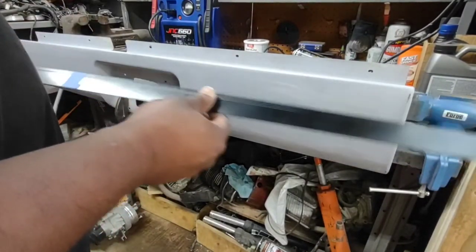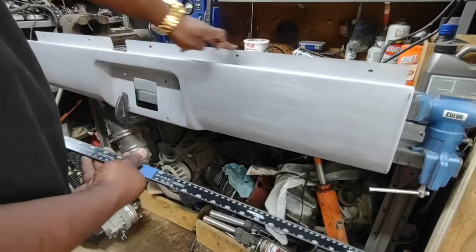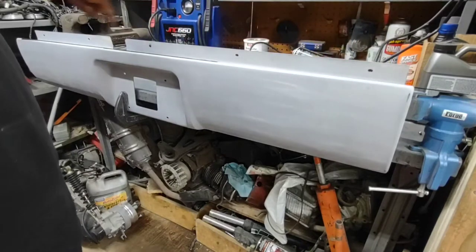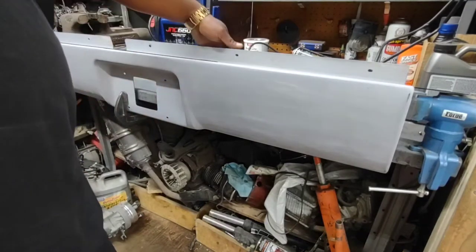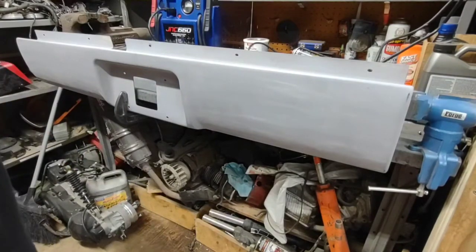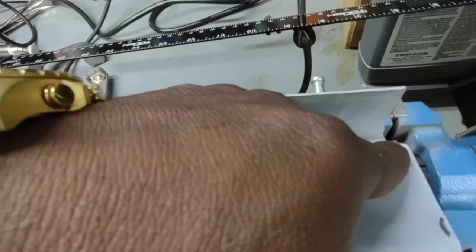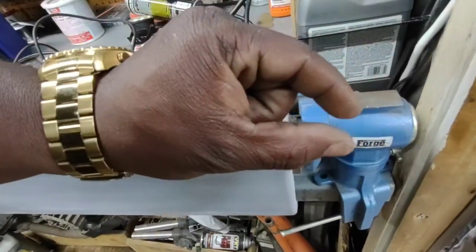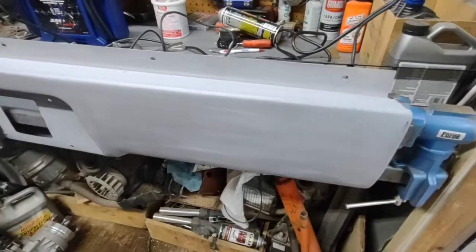So I had to go to Walmart and get me another ruler — one wasn't long enough, so I taped the two together. What I'm going to do now is go ahead and just cut the back flange off so I can get my ruler in here, clamp it down in place, and make me a line so I can cut the rest of the flange off. I got a little bit of angle iron out here I'm going to cut and we're going to just rivet it right on here. I'm going to put a couple rivets on it and go test it out on the S10 and see if we're close. The problem I was having was this bracket here is bent too far out, so the roll pan stuck out about as much as this space is here between here and there. So I'm just going to cut that off and put some angle iron on it, rivet it to it.